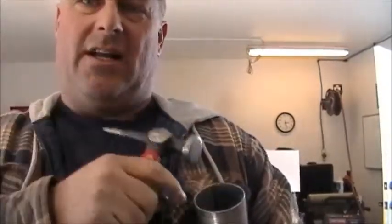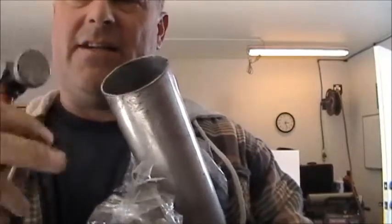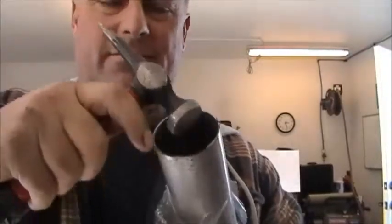This aluminized exhaust pipe — I swear it's annealed. It works really easy. You can very easily turn that edge down and even take that edge in. Take and flare this end out — just do the opposite. Work that thing around and you can get that flare a little bit, and you've just kind of made them match up.